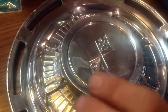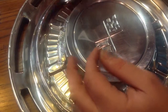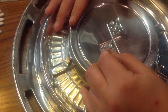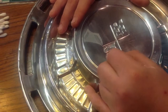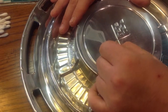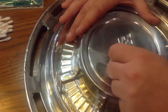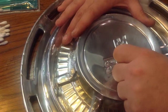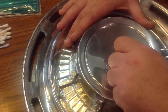The next thing we are going to do is take that dremel and just scrape away anywhere that we want to put paint. You have to create a rough surface for the paint to adhere to, so we are just going to scuff up anywhere we want to paint in a circular motion, basically creating scratches and sanding away the very smooth surface of the steel. Get into all the little small areas you are going to want to paint and scratch them up real good, otherwise the paint will not stick — it is too smooth and the surface just won't take the paint.